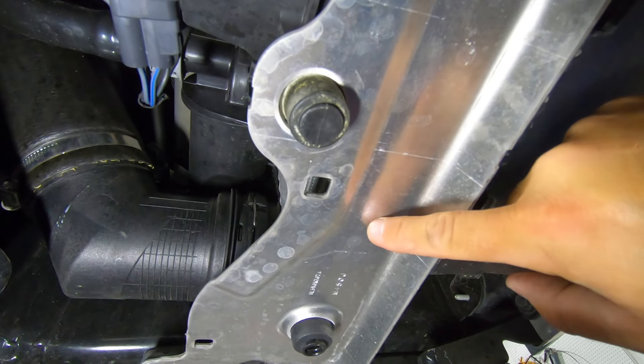The existing harness and the plug for the diverter valve are right over here — this is going to plug into our recirc/blow-off valve. The fan harness is right here, tucked up out of the way. Now all we need to do is drop the intercooler into place. We're aiming for the mounting holes — one on the right side, one on the left side for the intercooler top, and the fan goes in right below. Line those up and then it's smooth sailing — just reverse the process, attach the hose, and button everything up.